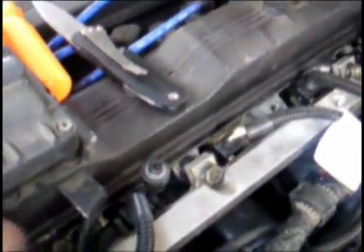And here we have the fuel rail reinstalled. The injectors definitely seat much easier with the Vaseline, and I have the fuel rail completely tightened down. If you watch closely, you can see that I can still rotate the injectors side to side, whereas before, without the Vaseline, it was impossible to turn the injectors. But it definitely feels like they were fully seated into the fuel rail, and the injector should sit flush and seat all the way down into the fuel rail on installation.